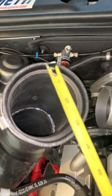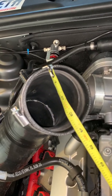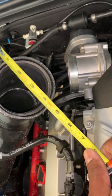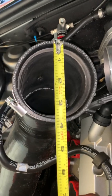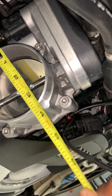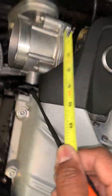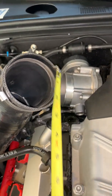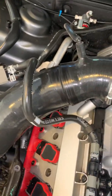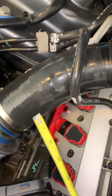I haven't checked IE yet to see if they're in stock or not, but the size is about three and a half inches for the silicone, and of course it has to be around the same. So if you're looking to get an 80 millimeter throttle body, go ahead and get the intake if you've got the money for it. I had to cut it because it's not going to fit anything else you buy unless you get a silicone that's big and then tapers down.